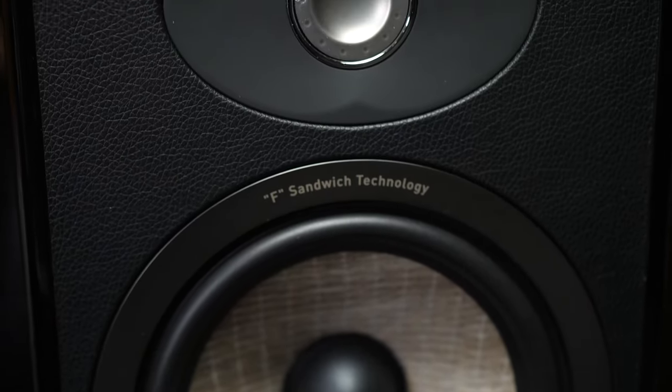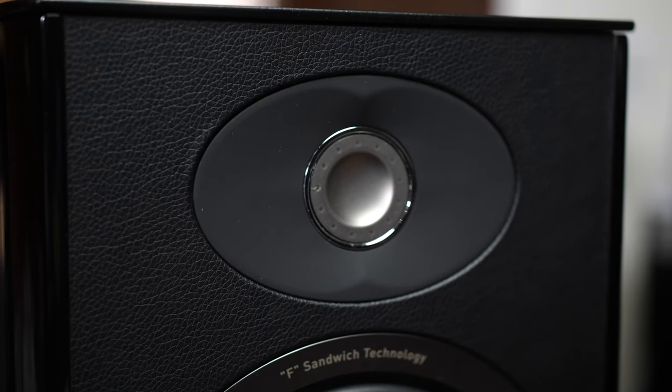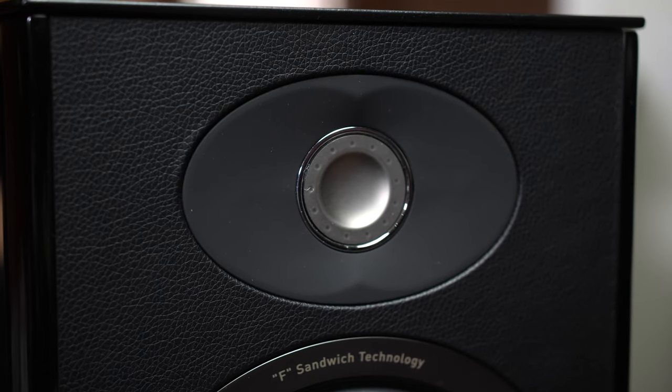That's what I'm talking about — it's another level of speaker design. Let's make our way up to the tweeter and see exactly what the inverted dome tweeter is about and what makes it different from a standard dome tweeter. First, the materials — they use an aluminum-magnesium tweeter because they want something light and rigid. With the inverted dome, that actually adds more support to the tweeter than a standard dome. With a standard dome tweeter, at the tip of the dome there is absolutely no support at all, and when you're cranking it for long periods of time it will start to shake and vibrate, causing resonances that aren't in the music. Focal has inverted the tweeter and added pretty much like a brace behind it, so that tip of the dome is not going to shake and cause those resonances.